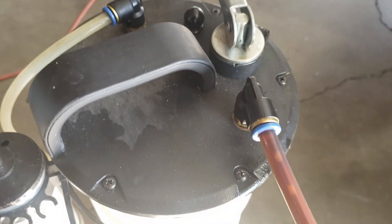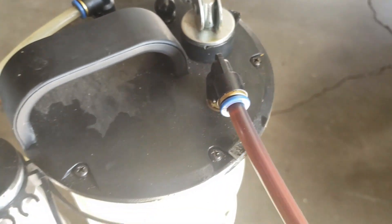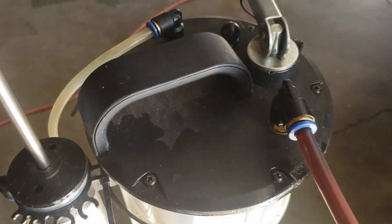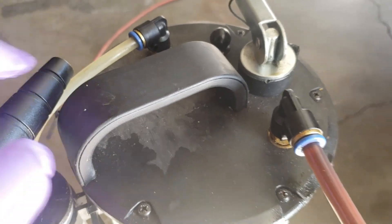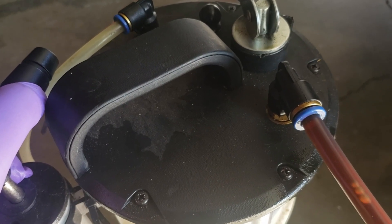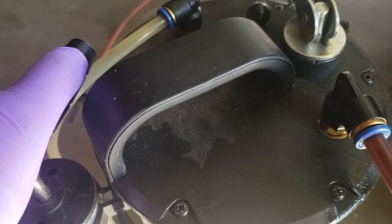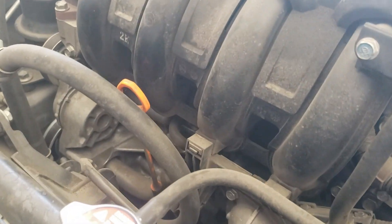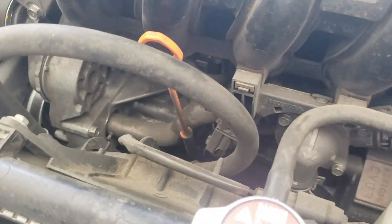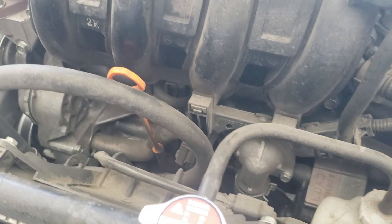Keep on pumping. I did want to point out that your vehicle might have a transmission filter, and if so you do want to change that as scheduled. However, if you're not able to get to it, you're better off at least changing the fluid. The same thing applies to oil changes — I've seen people go 20,000 to 30,000 miles without an oil change because they don't want to get under the car. Most vehicles can have the oil changed the same way we're changing the transmission fluid — through the dipstick — with the exception of some vehicles like Mercedes and BMWs.